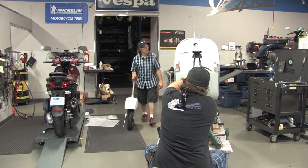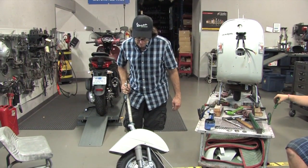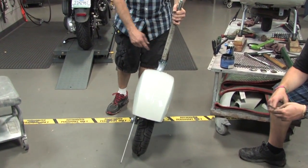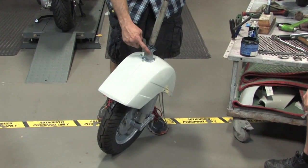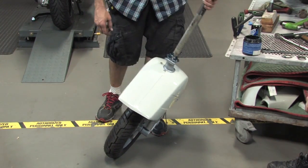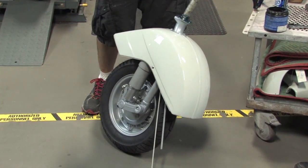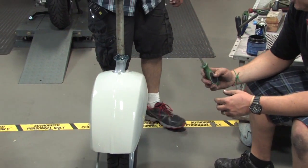Check out this fork — it's got some magical parts on it since I built it two days ago. I've got the fender on here. I want to talk about how I put the fender on: basically put the fender on before putting the bearing race and the lower grease cup on. The hole on this fender is a rounded rectangle — it drops over the steering stops and you've got to manipulate it right over those stops. Then the fender bolts on with three M6 bolts with washers and lock washers. On the side you can see I put a chrome M5 or M6 fastener with a nylock nut on the backside.